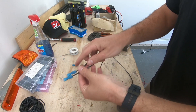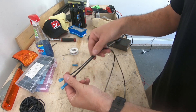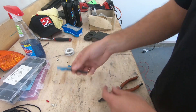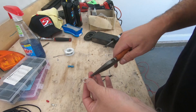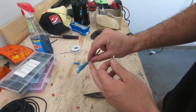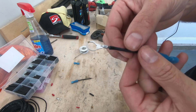Originally I did cut one wire to connect fog light to fog light for ground, but I'd rather not do that now — I just kind of thought differently. I'm just going to keep each ground connected to each fog light, and on the opposing end I'm just going to have a ring terminal which is going to go to the holes I just drilled in the frame and bolt in with a beauty washer or something like that. So I've got my two connectors already cut. For the ring terminal, I'm going to rip off this little black plastic because I'm going to put heat shrink over it anyways. I'm not against crimping them — I'm just trying to solder as much as possible. Now you can kind of see the soldered joint.